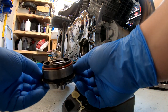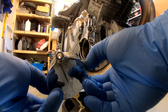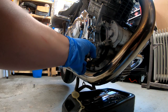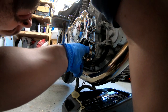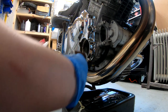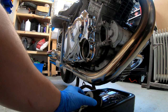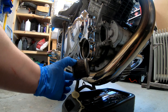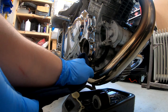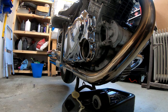So that's your oil filter cover. I'm going to check the o-rings — I think I'm going to have to change the outside one because there is a slight leak. Get the filter out; the filter might still have some oil in it, so just be careful. I usually just drop it in there. Make sure you remember which way is facing outside, because you don't want to put it the wrong way around. There is an additional o-ring on that bolt, and we're going to swap that too.